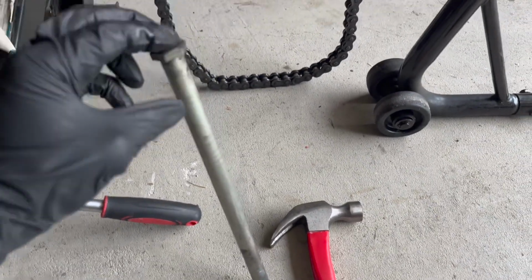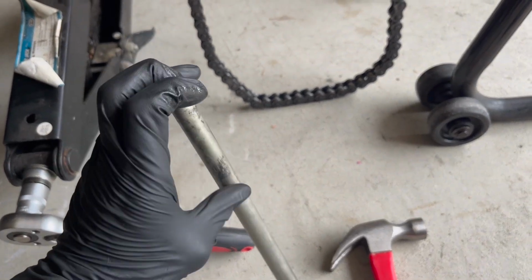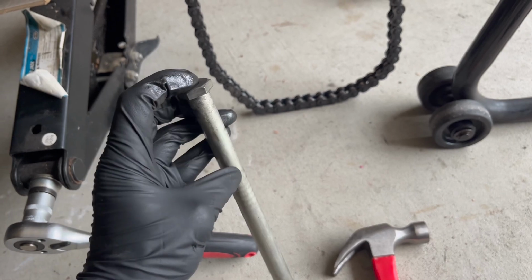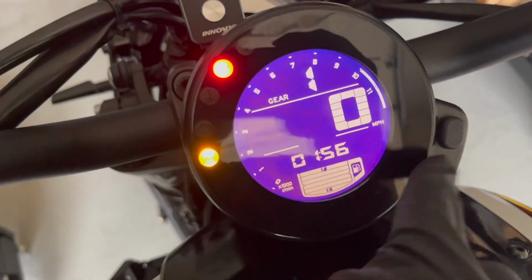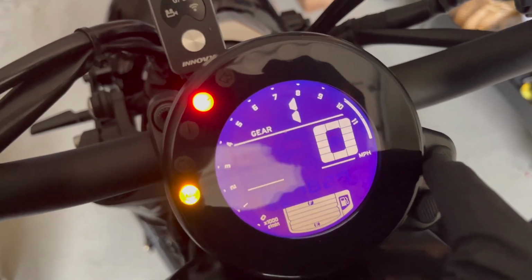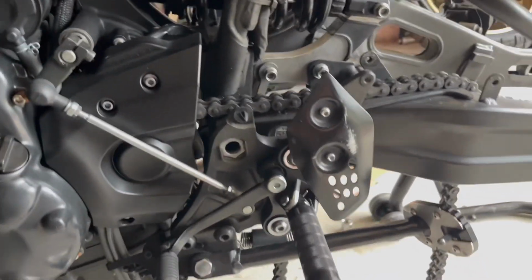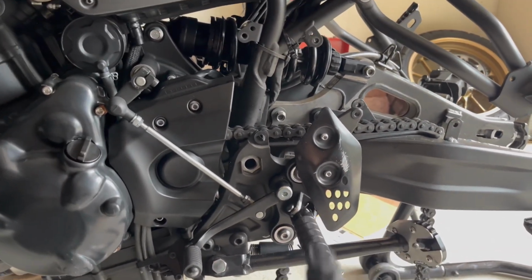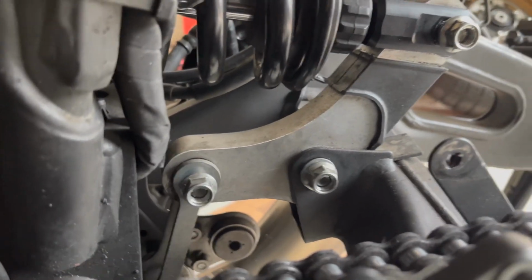and I'm not sure if you guys can tell, but there is still some lubrication on it. A very thin layer, but there's still some lube on it. I believe I have almost 18,000 miles on here. And they say in the manual to lubricate the suspension link pivots every 12,000 miles. So this rod was okay. Let's see what the link pivots look like.